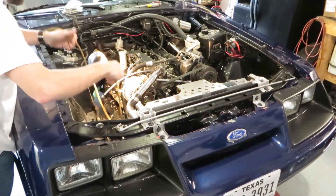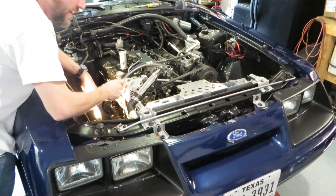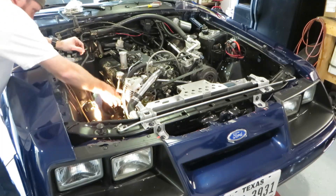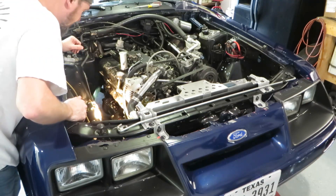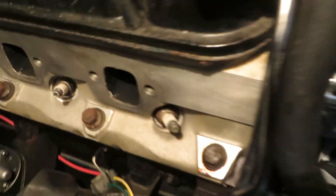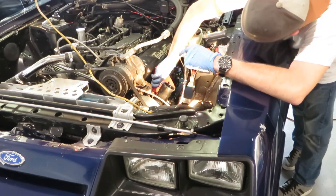What I'm going to do now is clean off the old gaskets. I'll save you guys from watching me scrape off gaskets, but I need to get all this gasket material off the heads and get them prepped and ready to install the turbo headers. Okay, I got the head surfaces pretty clean — it actually looks really good. Make sure you get every single bit of gasket material off.